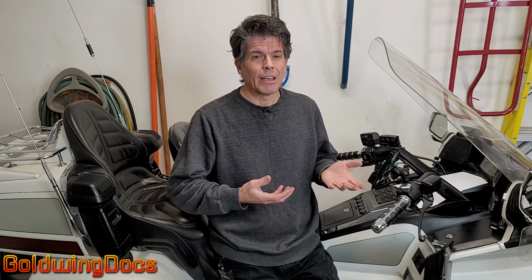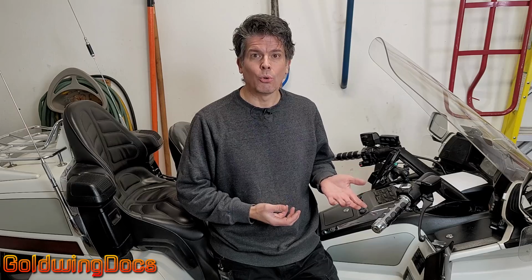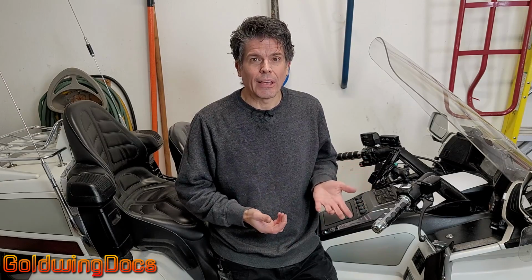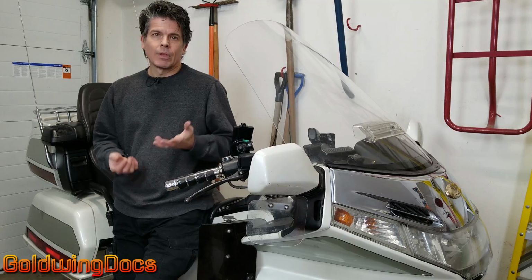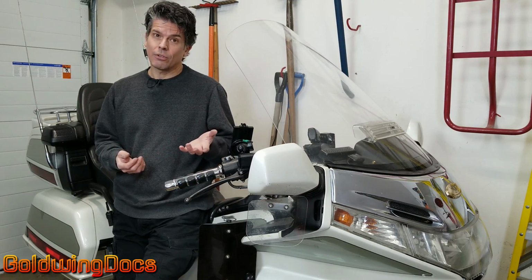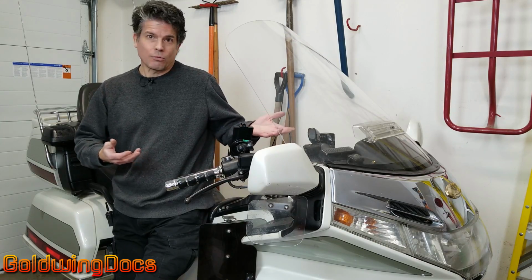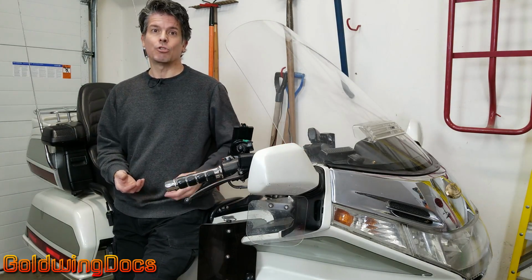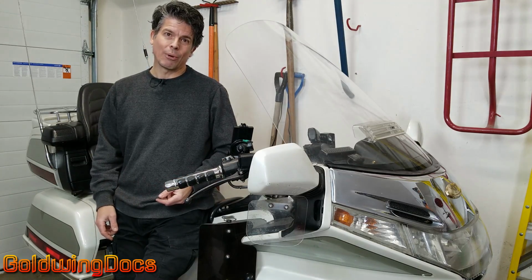After 5 years, especially if the bike has spent a lot of time outdoors or has been stored outdoors, the tires will get old and hard. You'll see the sidewalls start to crack. They just aren't as compliant as they used to be when they were brand new. So you definitely don't want to have a bike that has old tires on it. So if they're saying, hey, I just replaced the tires last year, and you look at it and the tire's date code is from 2014, maybe walk away from that deal.